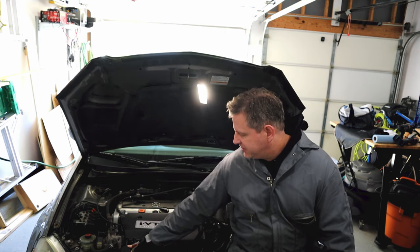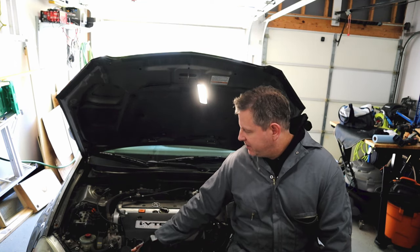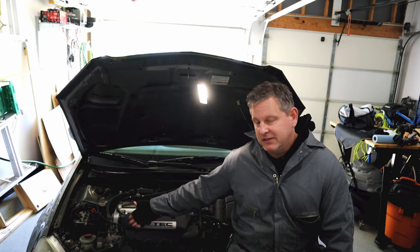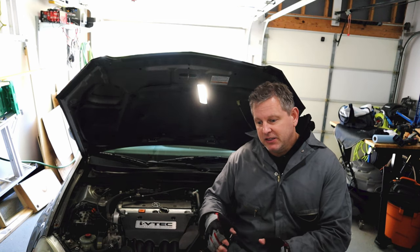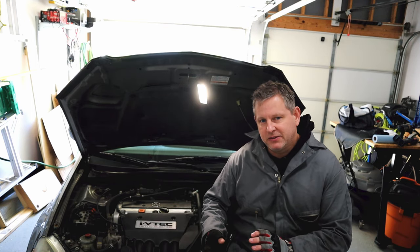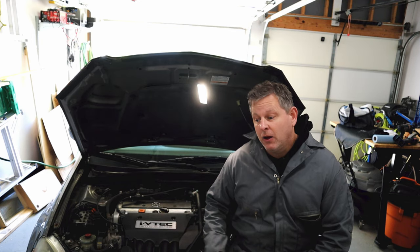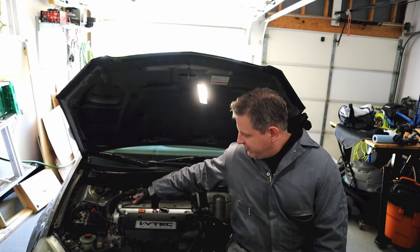I don't know if I pinched a vacuum hose or maybe the position sensor is bad. I did test the position sensor - it seems like it knows where it's at. Maybe one of the hoses has a hole in it, maybe the solenoid that controls it is faulty, or maybe we have some problem with the intake runner being gunked up. I read online that a common problem is the intake runner gets gunked up inside and when it does it can't move - it binds up or it can be cracked. So we've got to take this thing back apart.